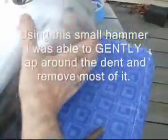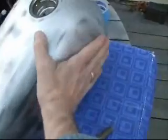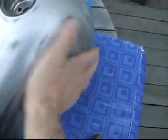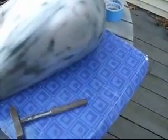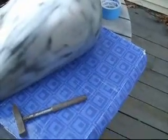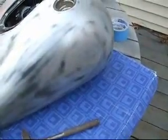It took the primary dent out. It will need a little putty to smooth it off. It didn't pop out nice and clean. But certainly less putty than the hole that we would have had to fill. So a skim coat of putty. We'll go over this. Just a coat or two, real thin initially, and that's it, and we'll continue from there.